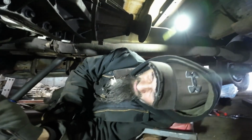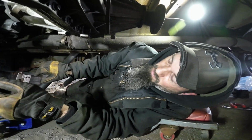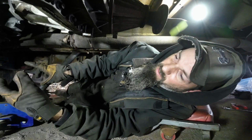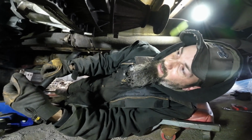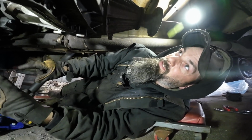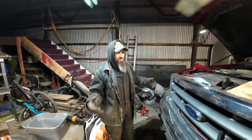So we'll get that shifter on the side, we'll get it up, get the mount in place, get the whole transmission cross member in, we'll get to the torque converter bolts, which are the 6 bolts that go through the flywheel, and then get the starter in, and we'll be real close to putting drive shafts in and putting transmission fluid in and driving. Today we actually feel pretty productive.